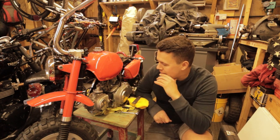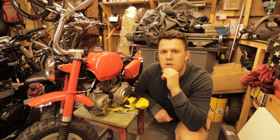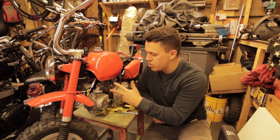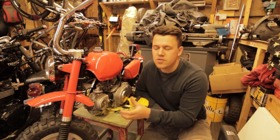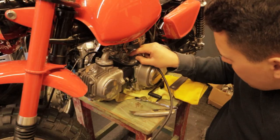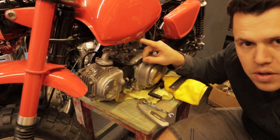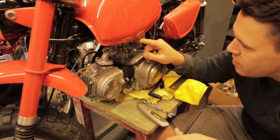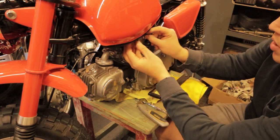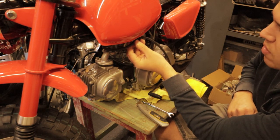The air filter's on and our tank's in place. Next up is the fuel line — I've got some fuel line and at the moment I don't have an inline fuel filter, so we'll run the length of fuel line from the tank to the carburettor. When a fuel filter comes we'll literally cut the line in the middle and drop the inline filter there. To spin the stopcock around so it's pointing in the right direction — because this is an aftermarket tank it's not 100% ideal, but I prefer the look of it nice and tidy. Fuel pipes all buttoned up, which I'm really happy about — it looks nice and tidy and the clips work well.